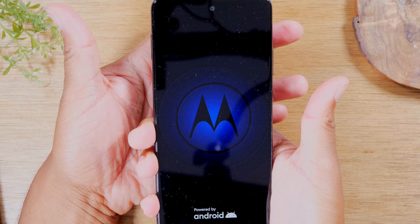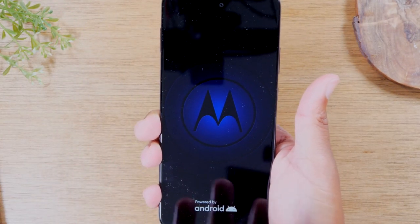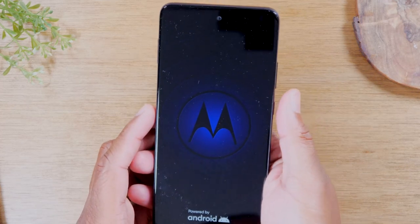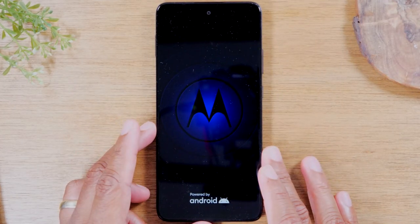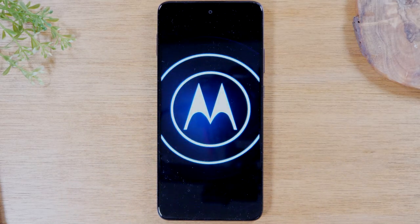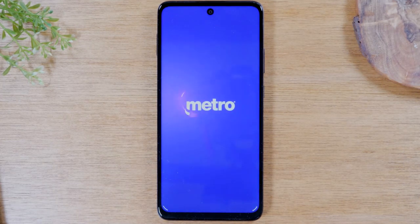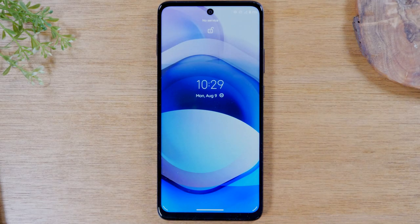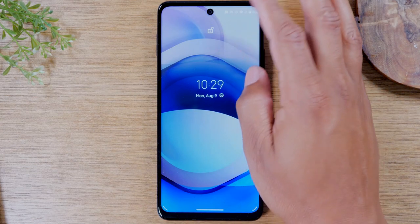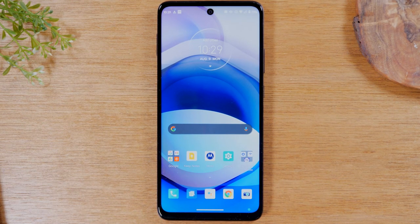Let go, and the phone should restart itself. If the screen goes dark but the phone does not reset, no problem. Just hit the power button after about a few seconds of the screen being dark. This will basically restart the whole phone. And usually if your screen is frozen, it means that an app may have malfunctioned in the background, or whatever is causing the phone to freeze. It should restart everything and clear that error out. So this soft reset usually will help to get everything back in line and get your phone working.